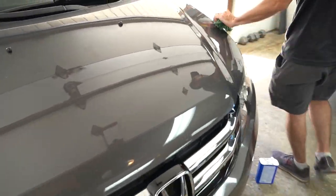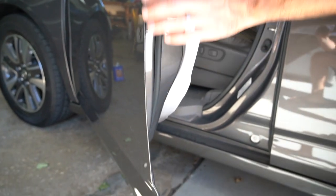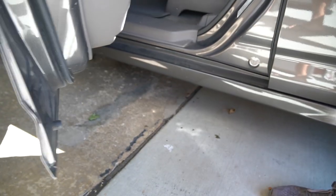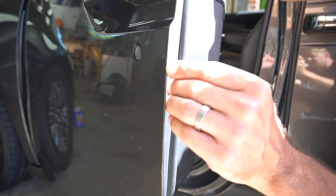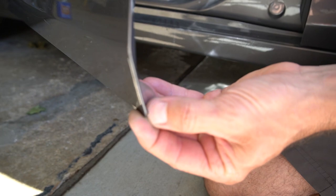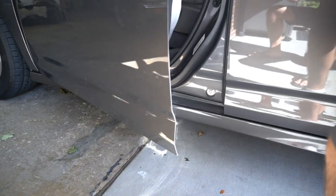Matt, come over. One more thing I wanted to point out. Important thing too, if you guys are doing touch-up at home, is to always check the seams of the door, because usually you go to the grocery store, someone, boom, they open the door, and a lot of times when I'm doing vehicle touch-up, I'll just inspect the corners. You can see there's a little spot there, and I believe down on the bottom we got a little spot where the metal's exposed too. So just something to keep an eye out for, but now the fun stuff can begin.